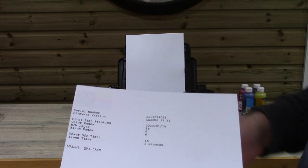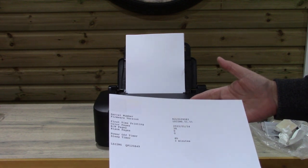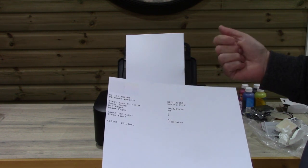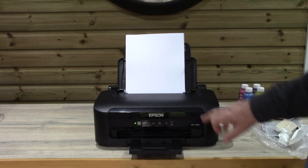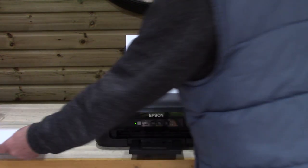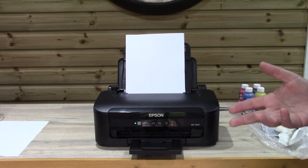I'm hoping that's helped you understand how to set your printer up when you receive it: put the genuine cartridges in, put the paper in correctly, check the paper to make sure it's not curled — if it is, roll it the opposite way — and if you forget to put paper in, it's simple to clear the fault just by pressing the button. Now we're going to get on to filling cartridges and installing the refillable cartridges.